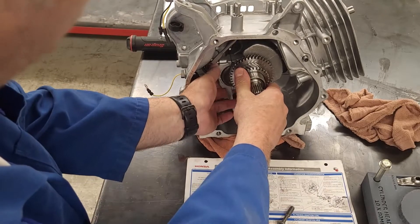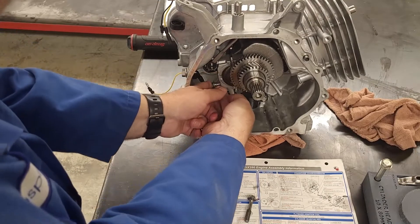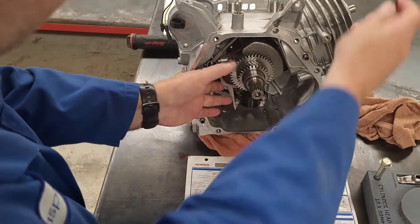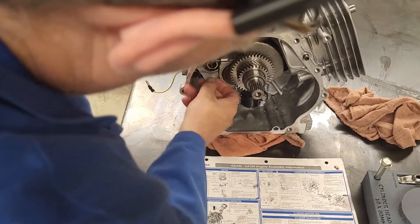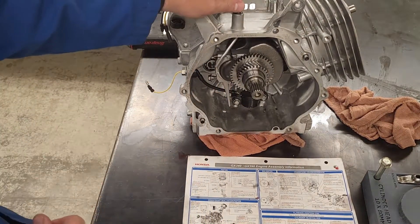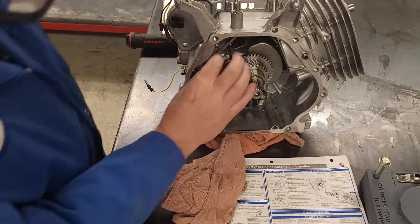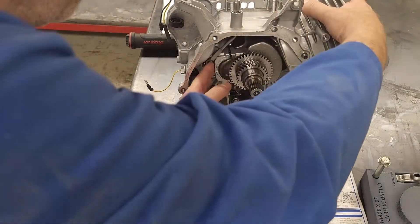It's a little tight in there, so I'll put the bolts in place. One thing I should mention is that the governor arm — you want to have it in before you start assembling, because it's hard to get in later. It's best to put it in sooner.